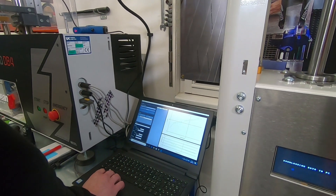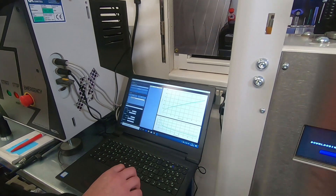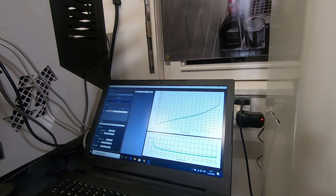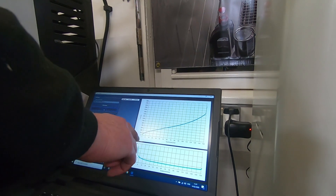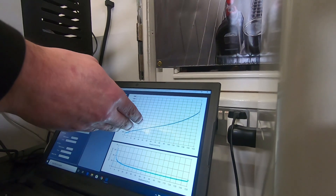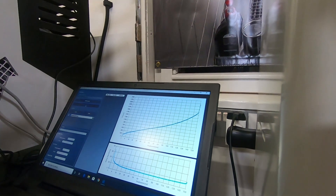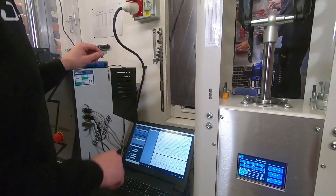So we'll download that spring curve. There we have a typical air spring curve which rises quite quickly in the first part of the travel, dips a little bit in the middle, and then is progressive towards the end. So we'll swap this out, put the coil fork in, and we'll show you the difference.